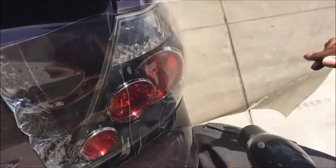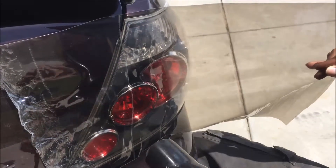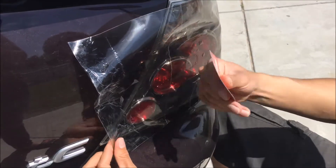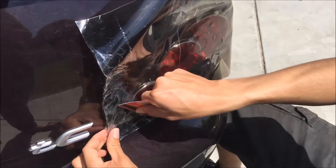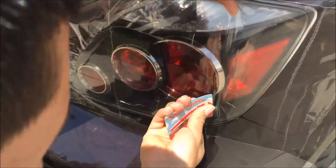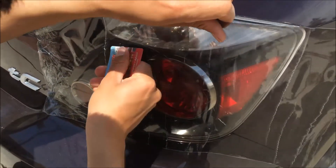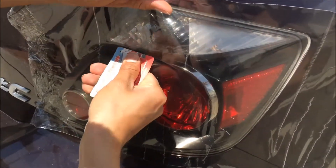I'm going to apply a little bit of heat here to this wrap too, to start getting the glue to work. You can also use any type of credit card to make it easier — just like this. See what I'm doing here: stretching out the wrap while at the same time using this card to take all the air bubbles out.